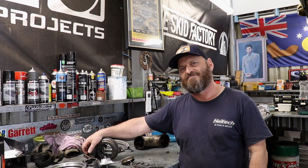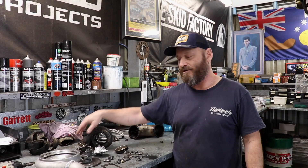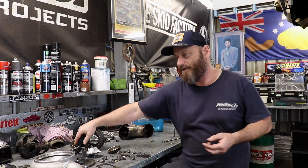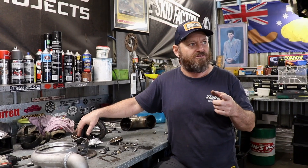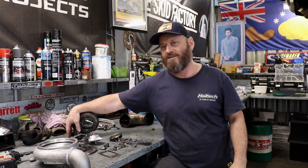The transmission is just way softer now with that mount. This was brilliant when the snap ring was still on there — it is much better. I'd already driven it a little bit. It's a big difference to the other turbo — just boost response basically. It felt like it went just as good to me. It's a winner as far as I'm concerned. That's the other thing about patrols — you don't need 600 horsepower in a patrol. You found out when you backed off after doing a full noise run and the thing tries to wag its tail off the road. It's a big four-wheel drive and it's not really built for handling. Lot of torque, about 300 horsepower — beautiful, perfect to drive. Even 200 horsepower with heaps of diesel torque is good in them.